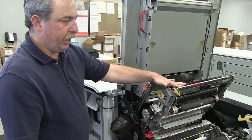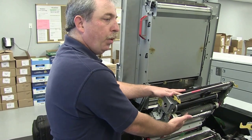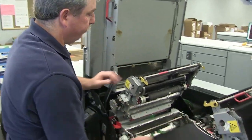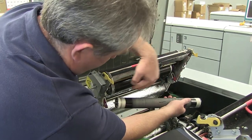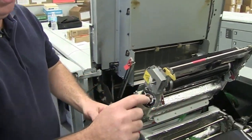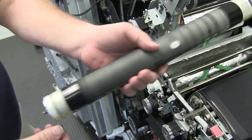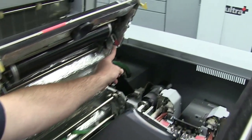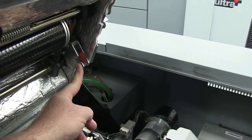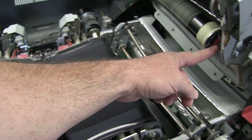I'm going to replace the secondary side. Just know that the secondary and primary sides are mirror images, so when you replace these, the steps are the same. You're going to reach in — there's a tab on the back and a slot on the front. These are shaped differently: one side has a groove in it, the other side is just a pin, and they fit in these little slots here. The one with the groove has to go in the wider slot. On the secondary side that's to the rear; on the primary side it's to the front, so you'll have the wider slot on the front.